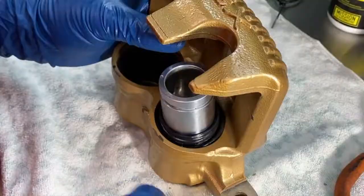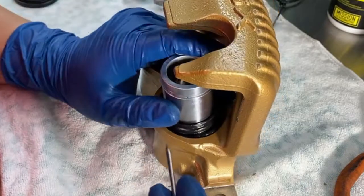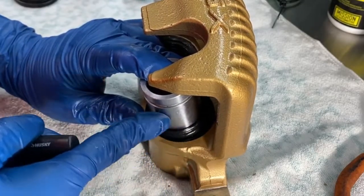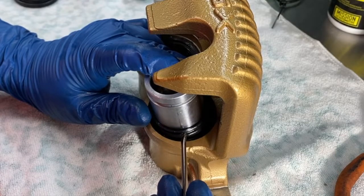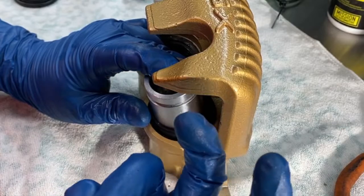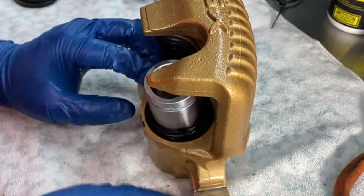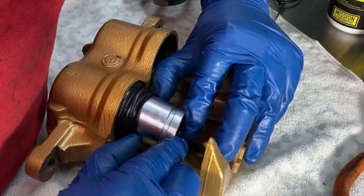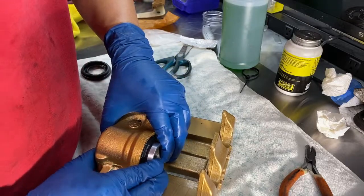With this Centric one, the dust boot is a little plasticky — almost like poly, not rubber. So I can actually hear it pop into the groove sometimes, which helps. You want to hold onto the piston while you're doing this so it doesn't go all the way out, because the hardest part is getting the boot diameter around the piston. Just hold it in a state of not too far in, not too far out. I'm going to test it — see, I know it's seated because it's not coming out. Sealed.